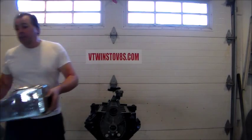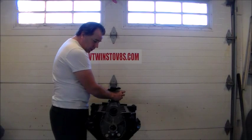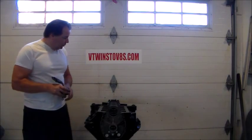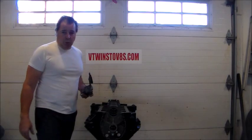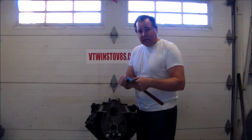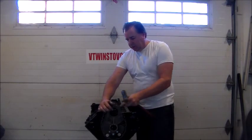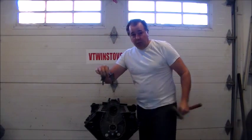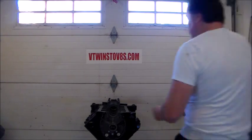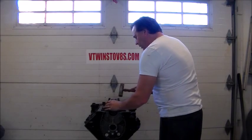Now we've got our oil pump all set and ready to go. I'm going to slip this off because the next thing we're going to do is take all these main bearing caps off and put the crankshaft in here, then check the crankshaft to make sure it's true. I've got all my bolts loose on all my main bearing caps. I've got a soft blow plastic hammer so it won't damage anything — I whack the bolts a little bit, walk the main bearing caps back and forth, and take them off. These main bearing caps have all been numbered from the factory, and I double-checked it on disassembly.